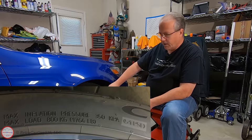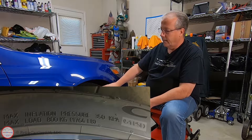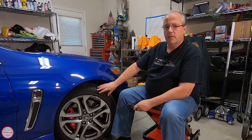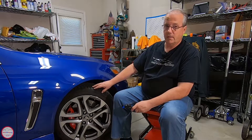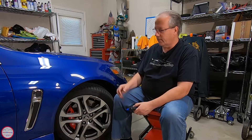We've looked at the label in the driver's door area — that's where you check for the proper inflation. Some people ask about the pressure stated on the sidewall of the tire. That is not what you're supposed to inflate the tire to when it's installed on your vehicle. That is the maximum value the tire manufacturer states the tire can go to in a worst case scenario — maximum value, and that's when hot. You should never really be anywhere close to that in normal situations. Follow the directions on the label in your driver's door area or your owner's manual. If you have custom tires and rims, it may vary slightly from the OEM recommendation, so check with the tire manufacturer or the installation facility for the proper inflation value.